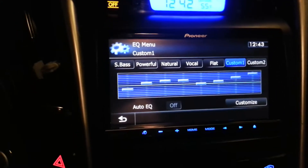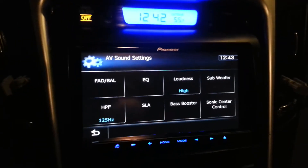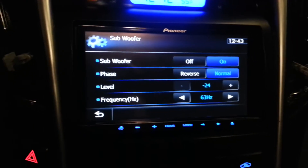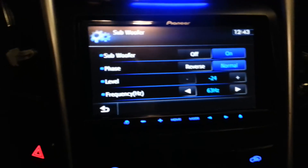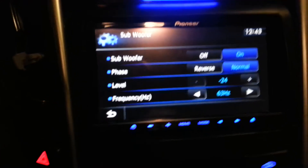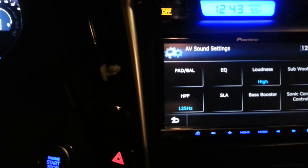You can turn the loudness in different variations. The subwoofer menu — I really like this. I can turn it off completely, normal or reverse, and I have it at negative 24 right now because sometimes too much bass is annoying. I really do like bass and I have subwoofers, but sometimes driving home from work I like to be mellow. You can really tune the bass way down or way up. I like the way you can set the frequency — you can go all the way down to 50 Hz, which is pretty low. I set mine at about 63 Hz for the bass, and I set my high-pass filter at 125 Hz, which makes it sound really good.